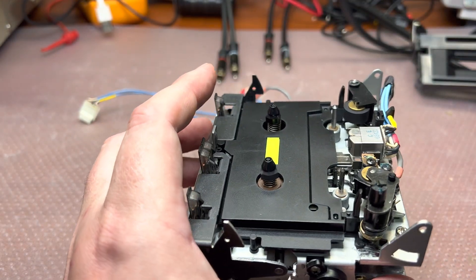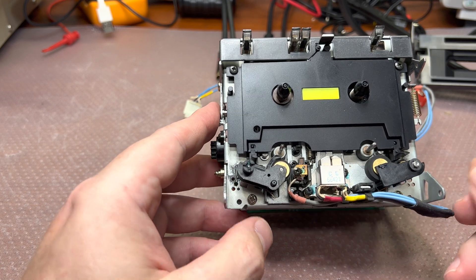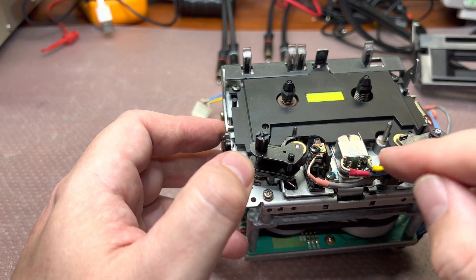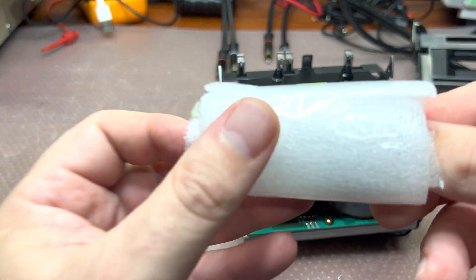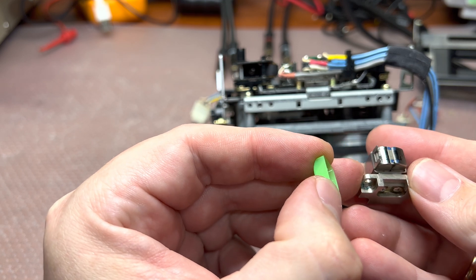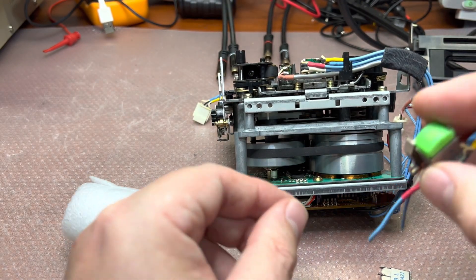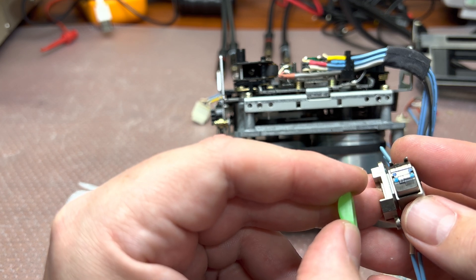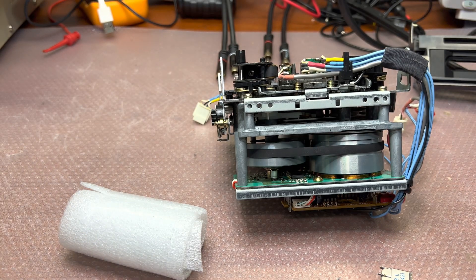Next step would be for me to replace this head, and I will be adjusting it — though I'm sure you should not do that in most cases. I will be unsoldering the wires, removing these three screws, putting the new head in, and soldering the wires back. I've got two heads from this customer — one of them looks promising with not much wear, just a little bit. The other one is in very bad shape — I looked under the microscope and it was pretty badly worn, with lots of grooves.